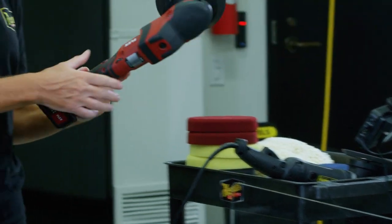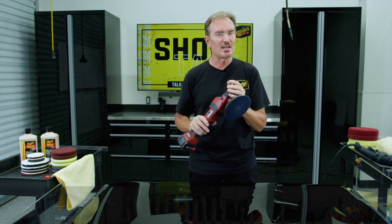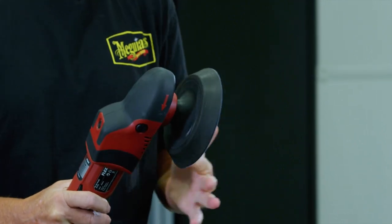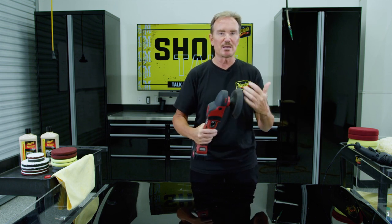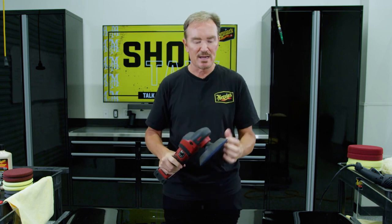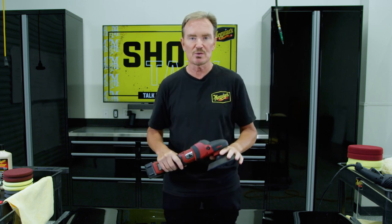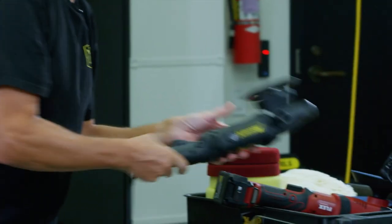Let's start with the rotary. This is a fantastic tool for someone who's got a bit of experience and really understands how to use it properly. This is a direct drive tool — if you are turning the backing plate you can hear the gear set turning completely through it. It's basically similar to an angle grinder: a direct drive tool that spins the pad in a perfect circle. Regardless of what speed you're running at, it is turning that pad in a perfect circle. It's not going to bog down because of pressure or contours. Very powerful tool — fantastic in the hands of someone who knows how to use it, maybe a little dangerous in the hands of a novice.